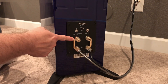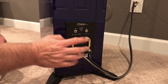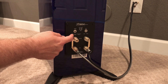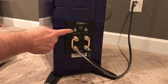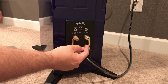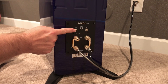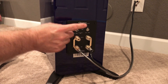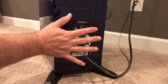Once you get your cabling in place, you could cable up here if you want to - it doesn't make any difference. The binding posts will carry the signal over these jumpers up or down, it doesn't matter. Now you have to select how you want to deal with your switches. You've got a treble switch, and this is going to give you either minus two, plus two, or no attenuation on your treble frequencies. For me, I keep this right in the middle, and that's what they call the home theater setting. Now if you want to do music, they've got a minus two. And then if you're behind an acoustic screen - an AT screen - they suggest doing the plus two setting. But for us, since these are primarily going to be home theater, I'm going to go ahead and put them in the neutral position. When I do decide to listen to two-channel, I'll just come back here and pop it over, but they'll sit in the neutral position whenever I'm watching movies.